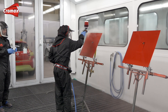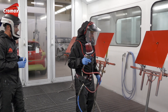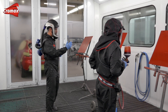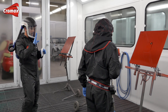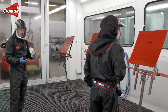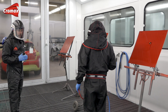As I said before, we have to apply a different number of coats, and we mark those panels with one and a half, two coats, and two and a half coats of the tinted clear. Tony applied now just one coat on those two panels. Now we give him a flash off, and then we come back with another one and a half, one coat, and of course here one and a half coats. The clear coat is adjusted, as we also will adjust it later on on the car, depending on the size of the repair, to be able to merge together the tinted and non-tinted clear.